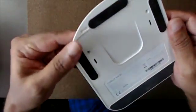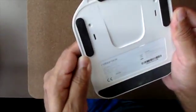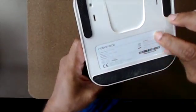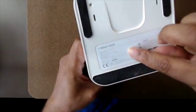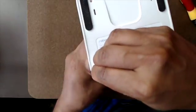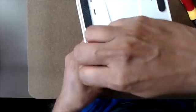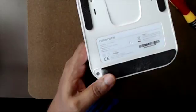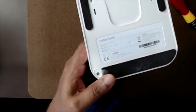it indicates to the service center that I have tampered with the warranty, and obviously once I do that the warranty is void. So when you tear anything down, do be aware that you void the warranty. It still didn't open easily, so I suspected the screws would be under the base non-slip sticker. I peeled off each corner and was able to find the screws.